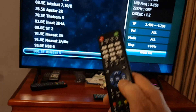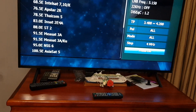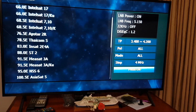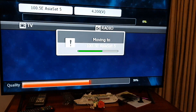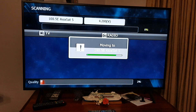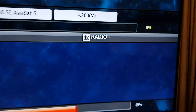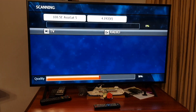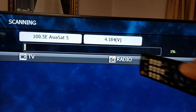Press the right arrow button on the remote to bring it to the screen. The easiest thing you can do is just press OK, and it's going to do a full scan of that satellite. This is connected to a motor, so you'll see the screen say 'moving'. For non-motorized versions it'll just start scanning. You can see it scans from the highest transponder down and starts building up a table.